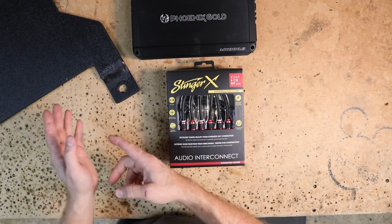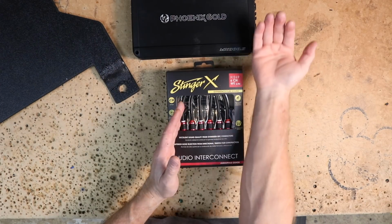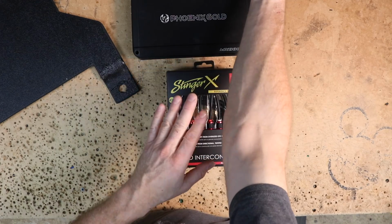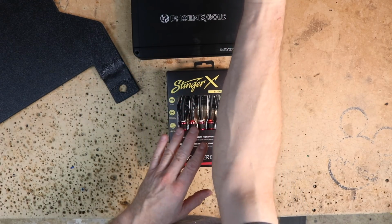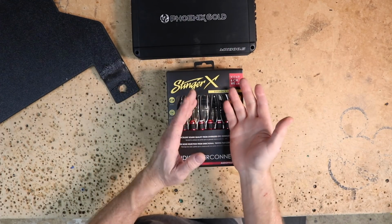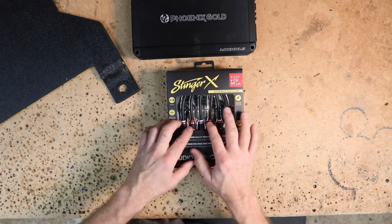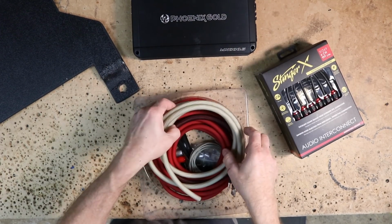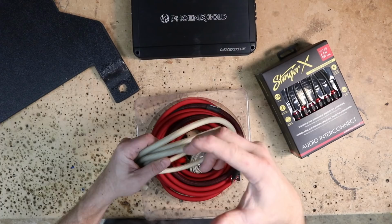We're not gonna be going out and up the driver's side. We're actually gonna be going up the center console. But in this particular vehicle, with the console you have to go really far forward up into the dash and then come back up and around. It's not a really tight turn. Normally we would just go with 6-footers, but because of that, we're gonna go a little bit longer and go with these. Fernando's already opened the kit to grab the fuse holder out of, which we'll show you once we get it into the car.